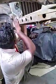And here you can see that a mechanic, Samira, is checking the new panel. This is the new panel. So this was the original. This was the version which was cut, which was badly corroded. So we are replacing it with this 1985 model Pajero panel. So this we have cut, and we are going to do spot welding from these areas down here. That's what we are doing.